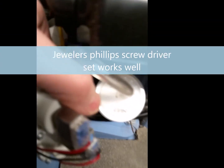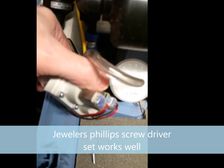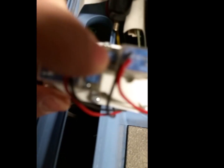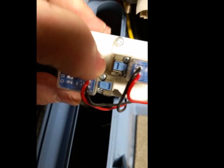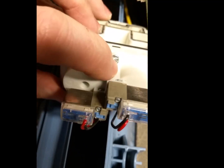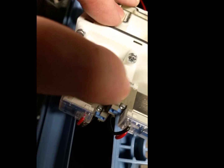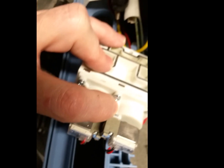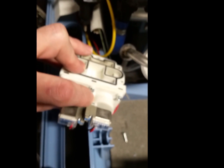I removed the five screws, so I'm going to remove this from the top — you see it just fell off. This is where it connects to the top of the sieve beds. Here is the valve housing, and these are the solenoid valves on the top. For the solenoid valves you've got to use a special screwdriver — generally a really tiny one — because what we're going to do is remove these tiny little top screws. In the bottom there's a little nut, and this screw runs through to the nut. Be careful when you remove the screw that you don't lose that little nut.